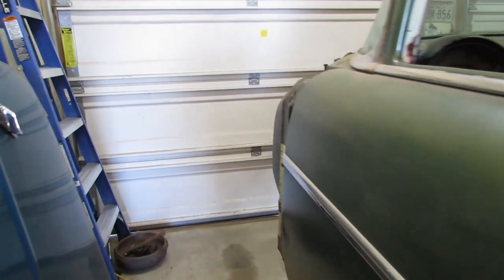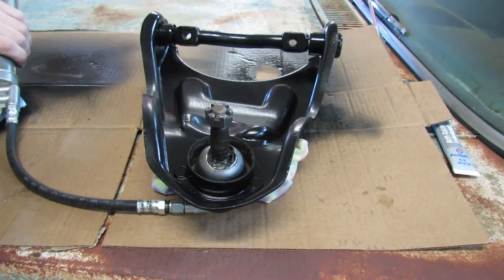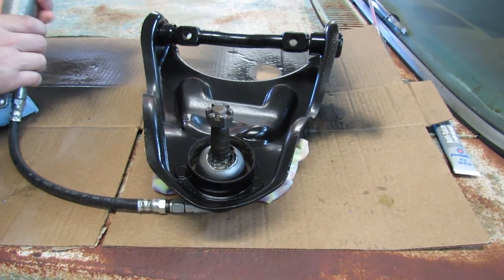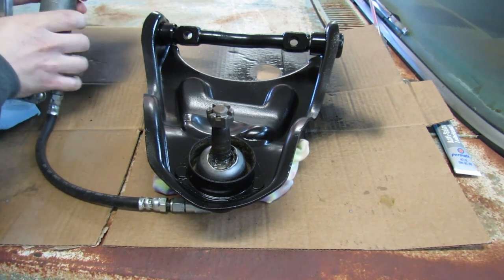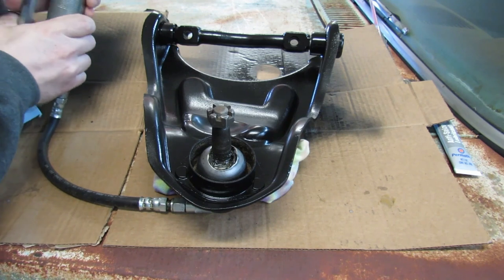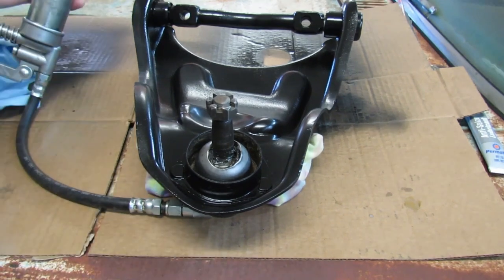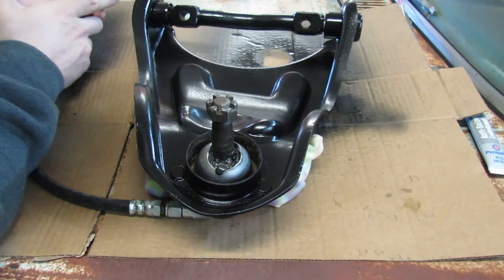All right, there's one more thing I want to do real quick, and then we'll start assembling everything up here. I want to get the last of the old grease out of the upper ball joints while the control arms are off the car and easier to access. I just want to take advantage of having the control arm out of the car here so we can really make sure we get as much of this old stuff out as possible. Because once we assemble these suspension parts on the car, and you got that coil spring, I'm pumping by the way, not getting anything out yet. Once we have everything assembled on the car, there we go,